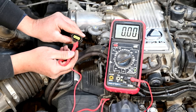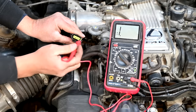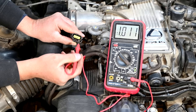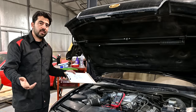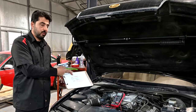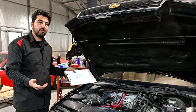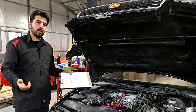We can check and make sure that last pin has ground by switching our multimeter to the continuity test. Make sure you don't test any of the other pins for continuity to ground. We got continuity to ground, so we just confirmed that the fourth one is our ground wire. So we've confirmed a bunch of things without the wiring diagram: we have the 5-volt reference voltage, we know which pin that is, we found the ground, we have almost 12 volts for the idle switch, and we found the signal wire as well.